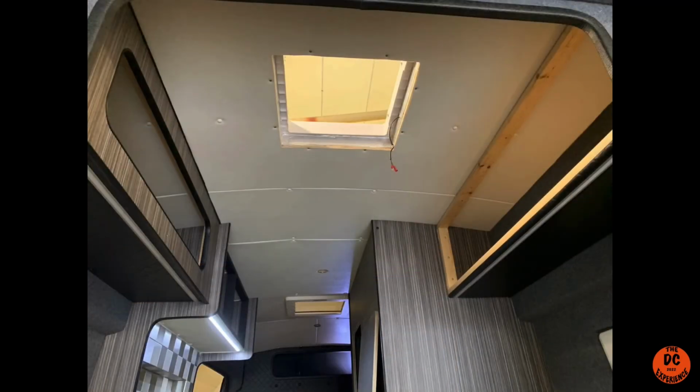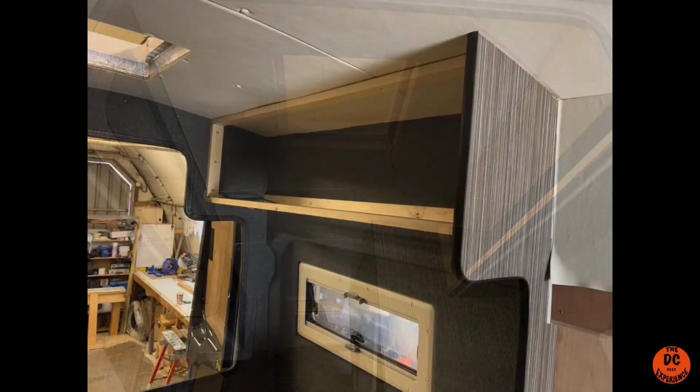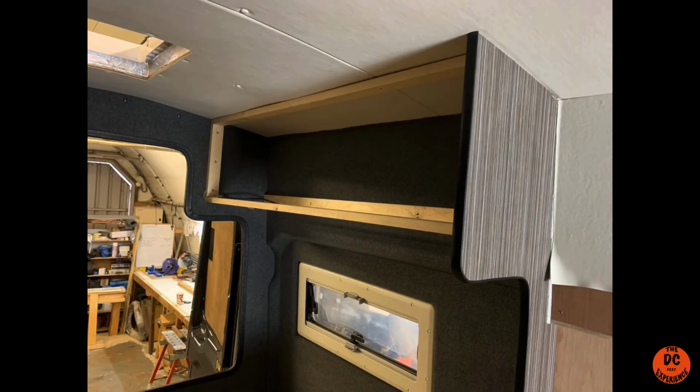You can see there on the left hand side, it was a bit further on in that picture, that's one of the finished lockers now with the front on. And that was working through. You can see also the bathroom has moved on. I'd got the side on the bathroom, the door wasn't on, but I had LEDs, which were then put in underneath the lockers too. And that was just a case of cutting out the plywood. When you get to this stage, just cut your plywood out, and then your furniture board out. Do it in a two-stage thing.